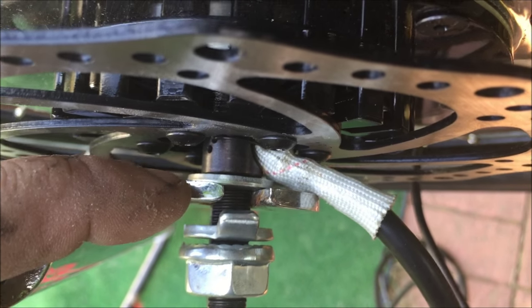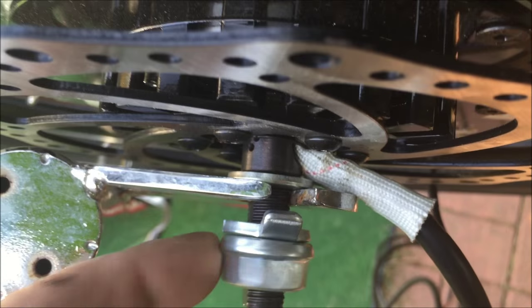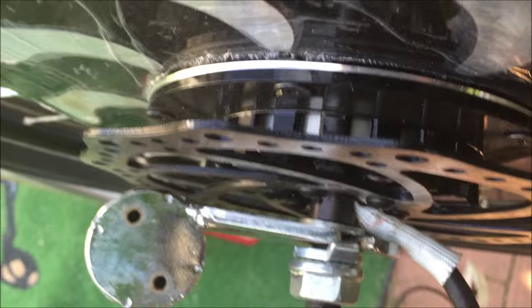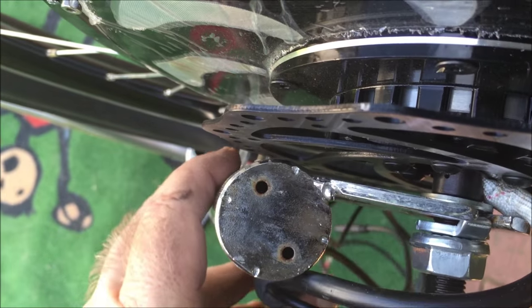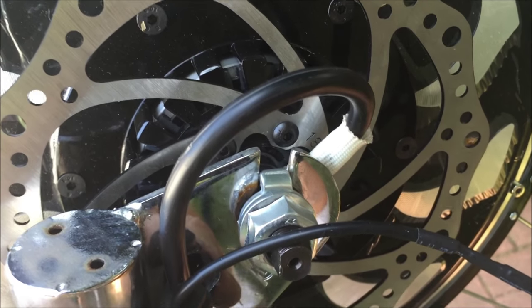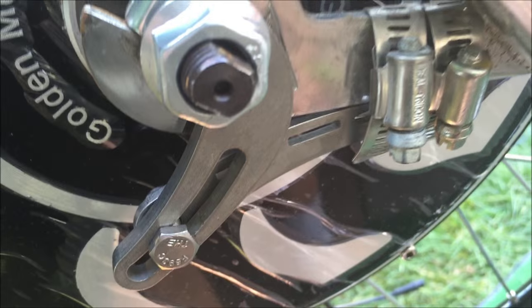You can see there's a washer inside, then the fork of the bike, then the tabbed washer that fits in the slot, and then the nut. Once tightened down, I'll run the cabling around to create a drip loop — remember this bike is upside down, so any rain that comes down the cable from the top will drip to the ground instead of going towards the motor.